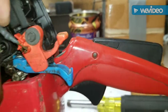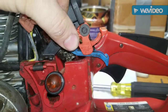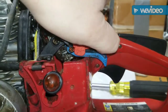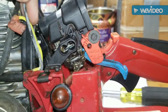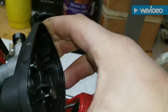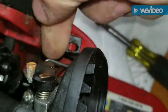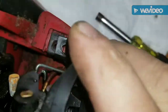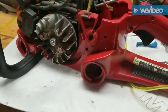Alright, I'm gonna get all that crud out of there. Got to take this whole thing apart. This little booger slides in and out of there — that's the kill switch, it's a thumb switch. Pull that out with this slide, take the two bolts off on the front, and she's coming loose. Just gotta disconnect the linkage down there and we'll be able to get it off.